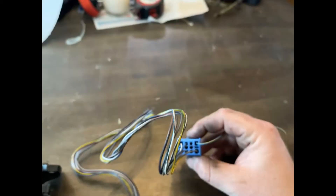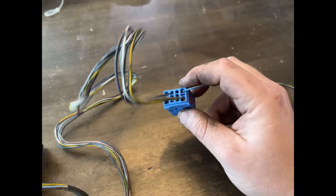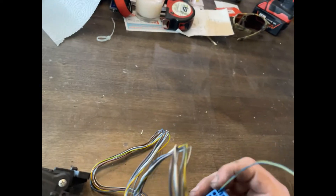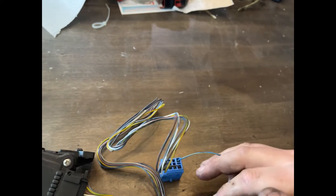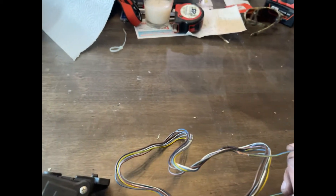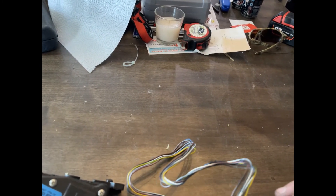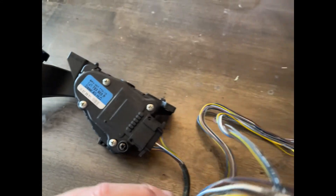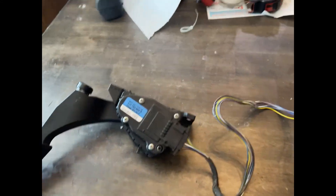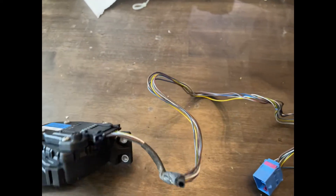There is one thing on the blue connector — a power sense wire for relay 109. If you connect this to switched 12-volt positive, this is the wake-up signal for the ECU. When you turn the key on, this gets 12-volt power. I think it's called the lilac-and-yellow wire from the sheets. I'm going to completely remove relay 109 and find another way to do it — it seems unnecessary.